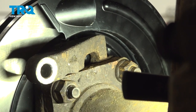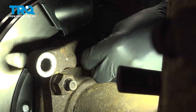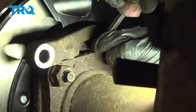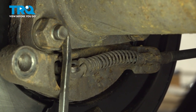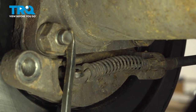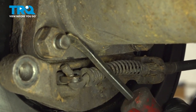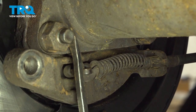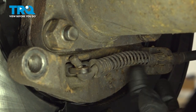Once you've made your adjustment, make sure you put on your protective cover. This should just slide right into this hole here. Once you feel as though you have it in the proper position, you can also use your small pry bar to press it in all the way. Once you feel as though you have the proper adjustment, make your way along the backside using a small pry bar. I want to pry up against this mounting stud and nut and up against the e-brake actuator. You want to make sure that this can move. If it only moves a tiny bit, you've over-adjusted. If it moves too much, you're under-adjusted. That pushes to right there, and then it stops — and that's where those parking brake shoes are hitting up against our brake rotor. That's a good amount of movement. If it moves too far, the parking brake is going to have to pull too far and the shoes won't hold.